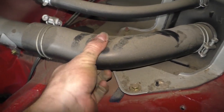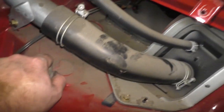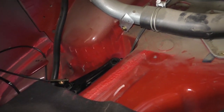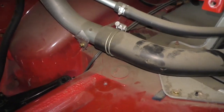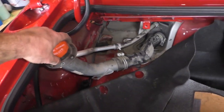Here's the gasoline filler neck - nice and supple. Here are the two bolts that hold the shock in place - there's one there, one in front. I think you should be able to get to those with an extension. It's just amazing how much dust got in here being a convertible. Little tip here: you're going to want to loosen your fuel filler and knock it aside - it makes it a lot easier to get to those bolts down there.